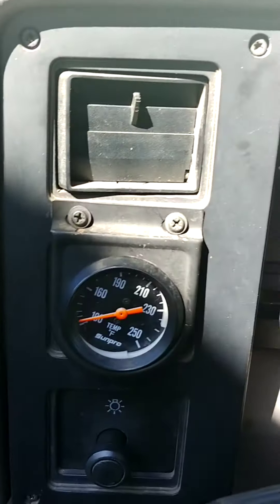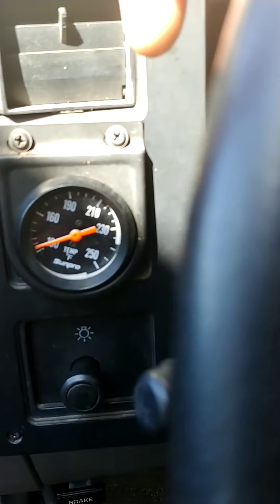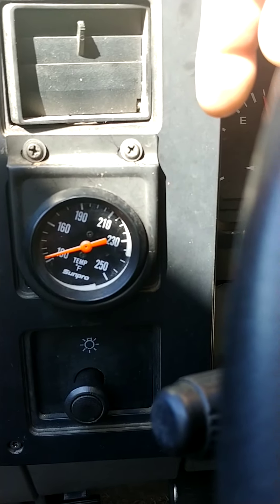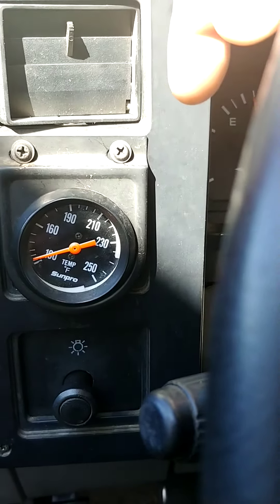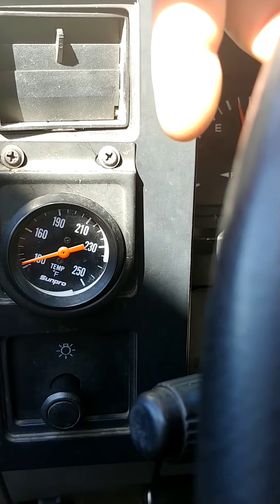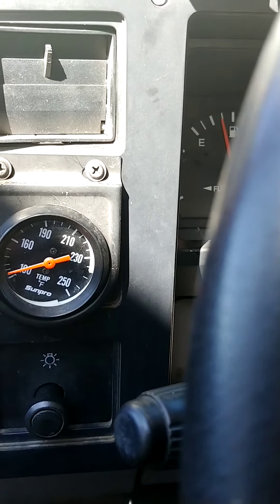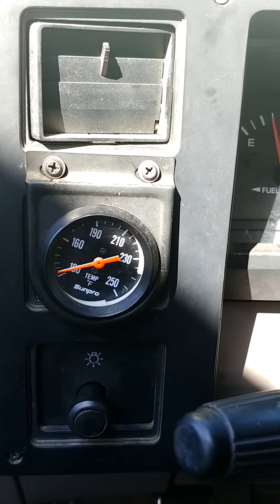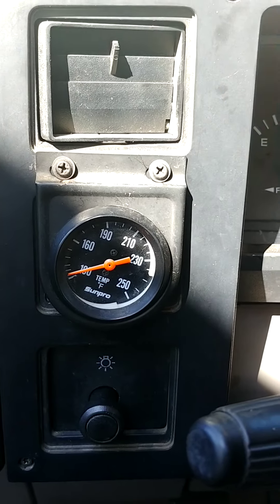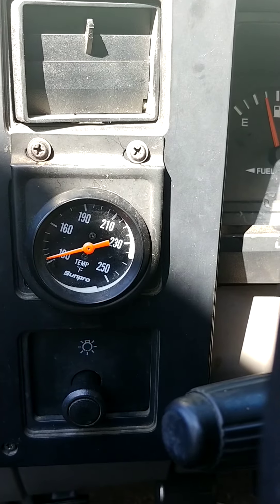Since I have the manual gauge and I did that electrical work and replaced the pump, I now run in temperature about 165 to 170 degrees going down the road. My fan doesn't kick on until 210. The truck used to run at 190 to 210, so I've dropped literally 25 to 45 degrees in temperature just by solving those electrical problems. If I'm sitting at idle at the bank drive-thru for half an hour like I did the other day, it went up to about 210 to 212, then the electronic fan kicks on and pushes it back down. But it's running a lot cooler on average than it had been, just by changing out those problematic electrical pieces.